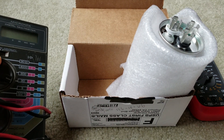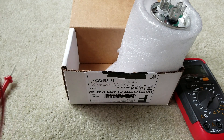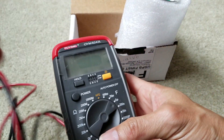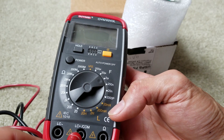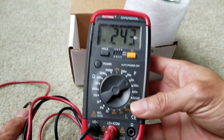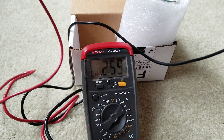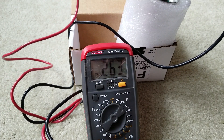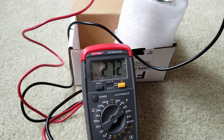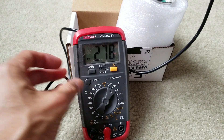I've got my meter right here to test out the capacitance. The battery is kind of low on the meter. I have a positive and negative — let me turn it on. I'm going to connect the black wire to the COMMON and the red to the FAN. I'll change the setting to 20 microfarad and see.